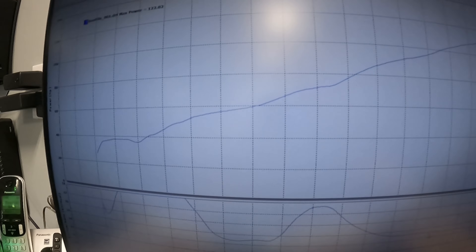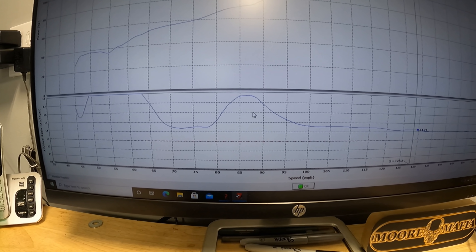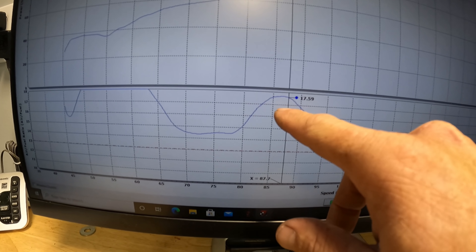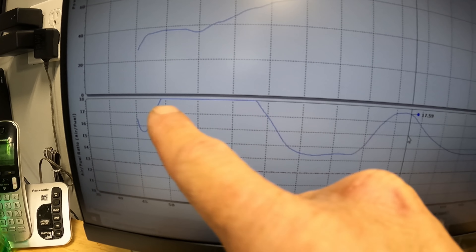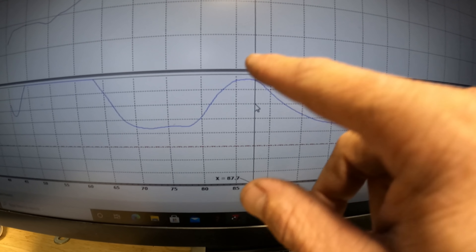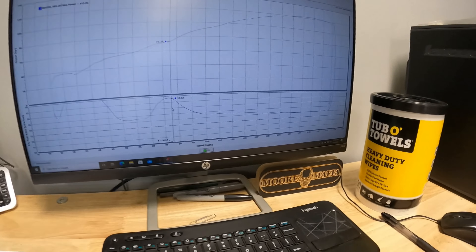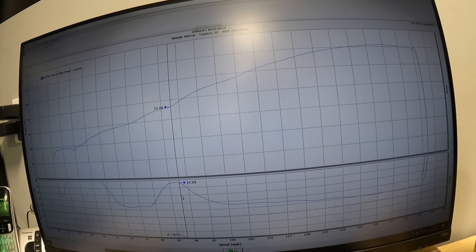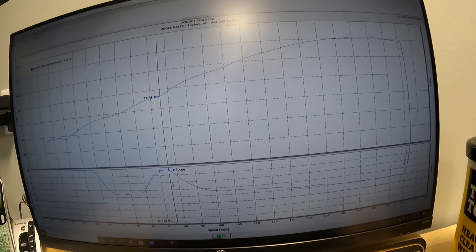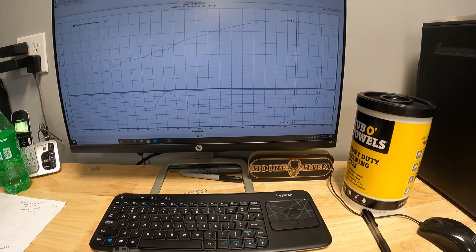All right guys, I want to take a quick second to show you a little bit about what's going on. This is our air fuel ratio chart down here. The higher the curve goes up here, the leaner the bike is — lean means not getting enough fuel. So you can see we maxed out the gauge here on the dyno, and we almost maxed it out right there, and then we're too lean out here. Now the crazy thing was this ECU has been flashed by another company. Sadly enough, just because you have a shop doesn't mean you should have a keyboard and flashing equipment. Remember guys, not everyone with a stethoscope is a doctor. So we're going to get this thing straightened out and get it doing what it needs to do.